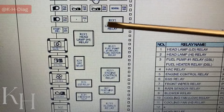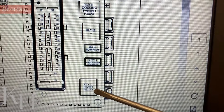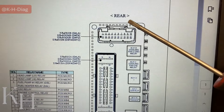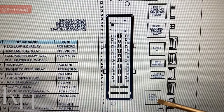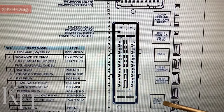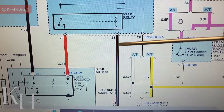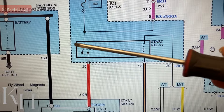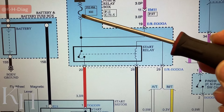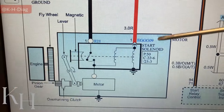If I find the PCB fuse box details, I can see this: the PCB fuse and relay box details show the part that wasn't shown on the engine fuse box diagram. There are many relays inside the PCB fuse box, and our starter relay is right here on the rear side of the PCB fuse box. When battery positive is provided and the negative ground is provided by the ECM, this relay will be energized and it's going to close this switch.